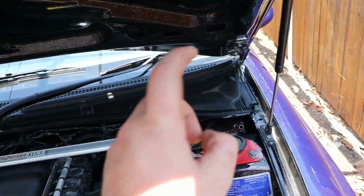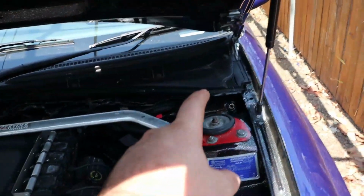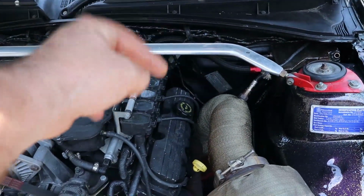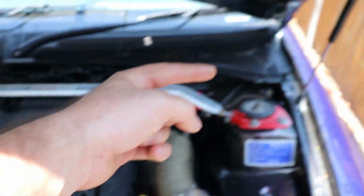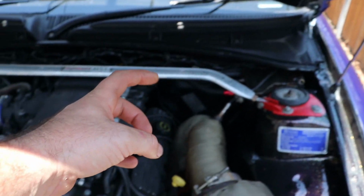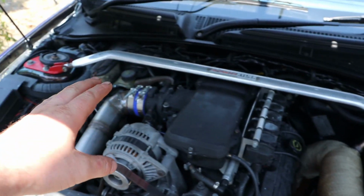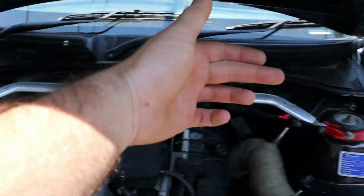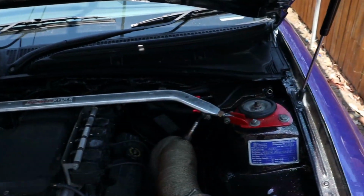I have a couple of welding jobs. I want to get the catch can out and this rocker cover off, so I'm going to add a breather from this rocker cover over to the catch can, and then later on, once I get a bit more money, I'll add another one from this side and it'll tee into this one, into the catch can.